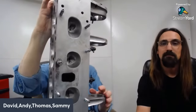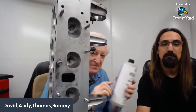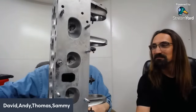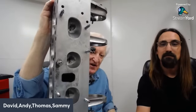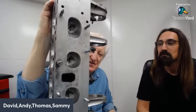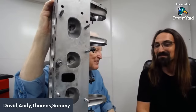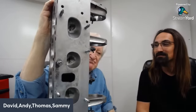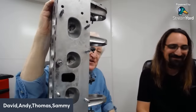We're going to put the boost up probably to around 40 PSI. And I'm anticipating that with 180 inches instead of 150, it's going to make four digits. I think the first run you'll get will be well over 800, right? But it will need tuning.